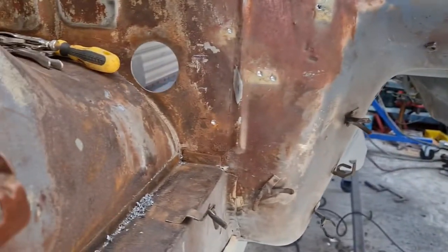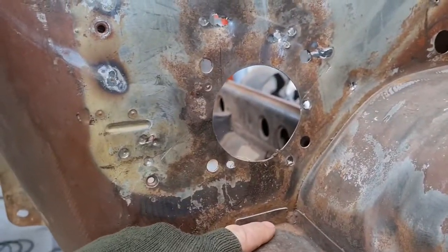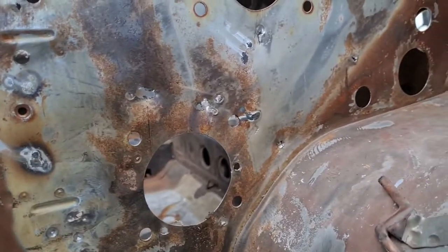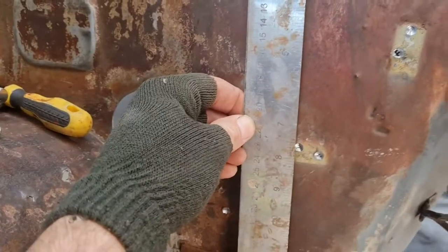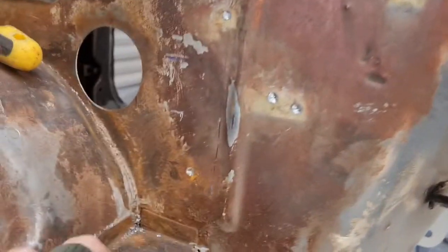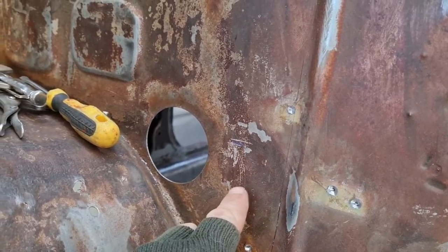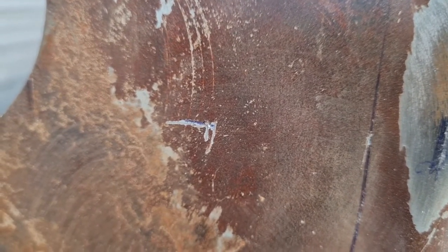I've transferred the position over. I took my verniers — you can do it with a measuring tape as well — and just took a height from point to point. I leveled the car and used a level to draw a straight line up as two reference points of the edge. Then I measured from that line back and out to the far side. Knowing those four outside points, I basically halved it and etched in a pinpoint right there. That will be where I start trimming and cutting. I hope I have a core drill somewhere to get a good start on it.